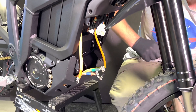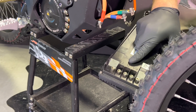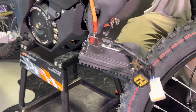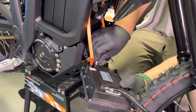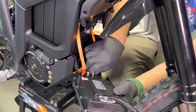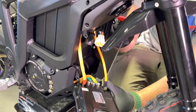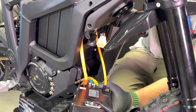Grab the new controller and if you look at the bottom here you can see all of them are clearly labeled. You have positive, W, V, U, and they are all labeled. Positive is the red one and it's the one way over to the right side of the bike. Start by getting these on with your fingers — I like to start all of them by hand and then tighten them down with the wrench. You don't want to go too tight on these; you can break off the stud if you really crank them down. So no more than five to seven Newton meters on these.